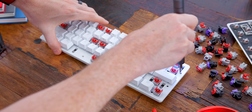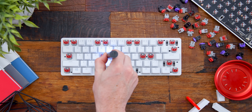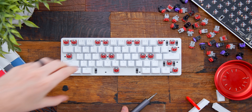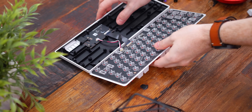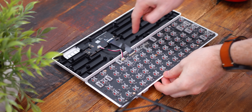To take it apart, don't worry, it's not too complicated. There are 13 screws in total you'll have to remove to take off the top plate. Don't lose these. But once they're all out, don't just rip it apart because underneath you're going to have to be careful — there is some wiring going on that we're going to have to disassemble. My recommendation is to open it from the top side down, so it's easier to work with those cables.